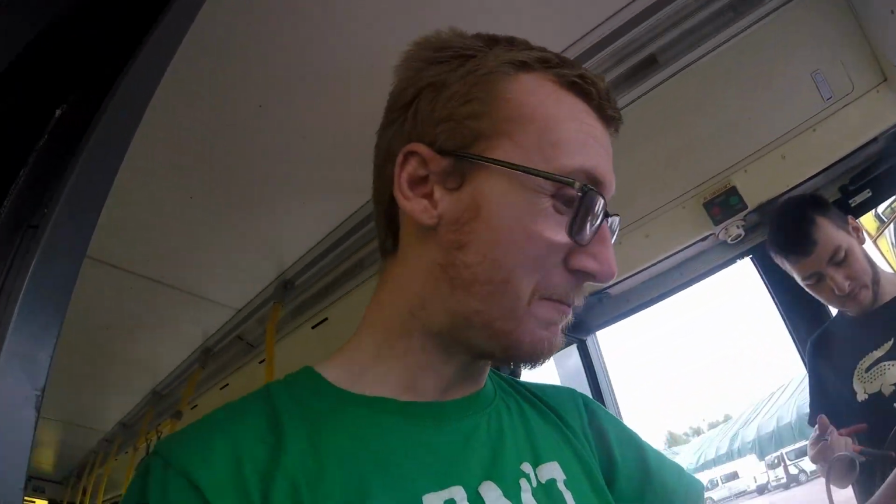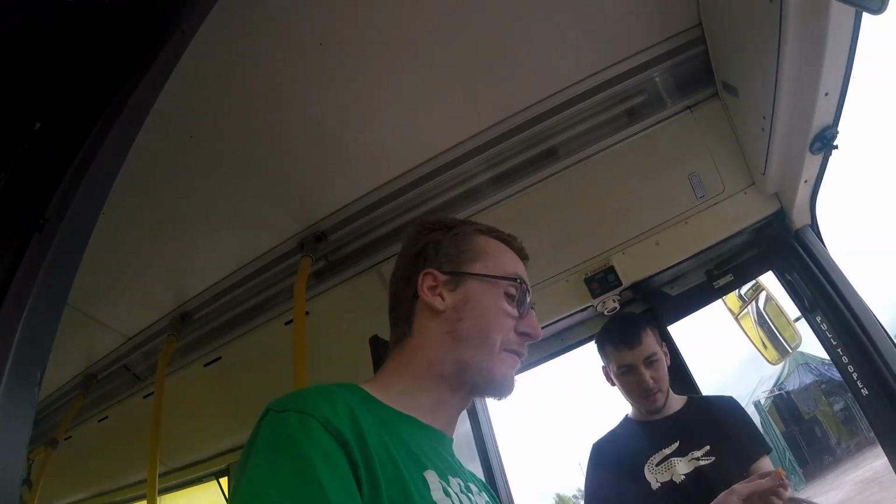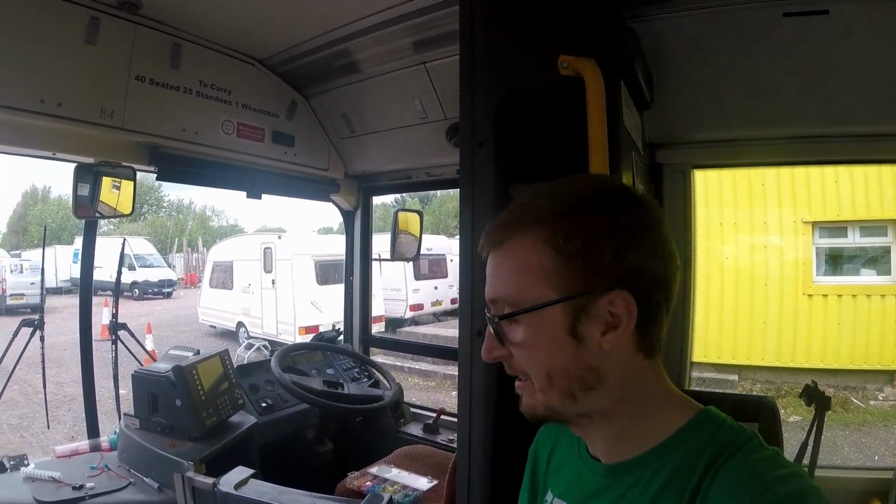What do you want? 30 amp? Well, Eddie, what have we got the most of? What's going to be less used on the bus? Probably 30 amp, innit? Yeah, but 30 amp's still quite a lot of power, isn't it? Yeah, but it's had 100 amp through it. Maybe a 5. We'll try a 5. Because all we need it to do is, when it shorts, if the cable comes off and shorts out, blow the fuse and not the wire.